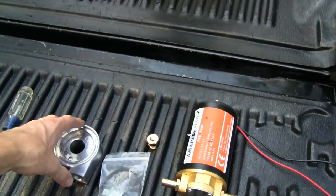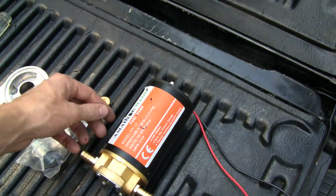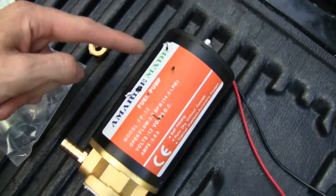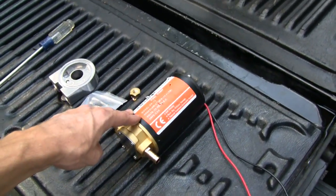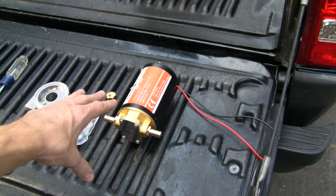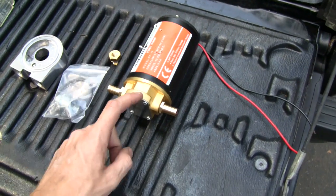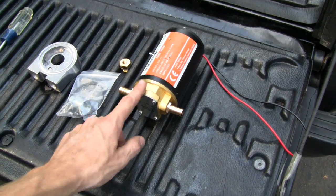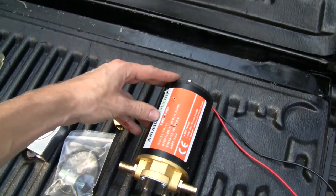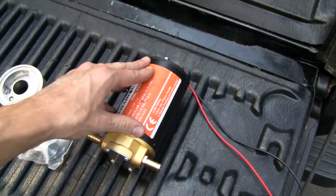I'm in the process of gathering parts. I just got this oil pump here — picked it up on eBay, pretty cheap. I'll leave a link; they also sell them on Amazon. Even though it says fuel pump on there, it's sold as a turbo scavenge pump. In certain turbo configurations you need a pump to scavenge oil out of the turbo, and that's what these are sold for. It's a gear pump — not one of those impeller pumps, it's got gears inside — so it should do the job pretty well. There's a guy on YouTube who did some pretty extensive testing with it, and I was pretty happy with what I saw.